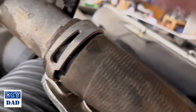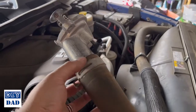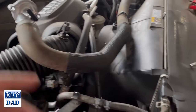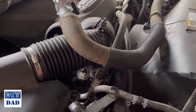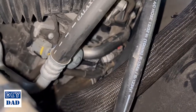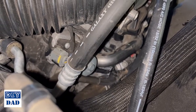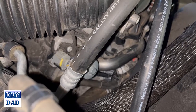My new thermostat is installed — got the line on the hose matched up to the center of the tab on the new unit. I fed it back down, got it loosely placed, then threaded the screws in to use them to align the assembly, since clearancing in there is not fun. Thermostat is reinstalled and all snugged up on both the top and bottom bolts. Tightened to about 20 foot-pounds, so we should be good there.